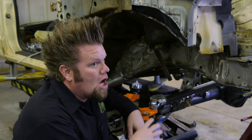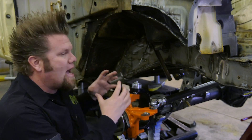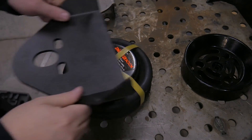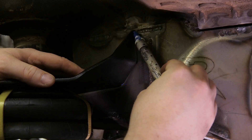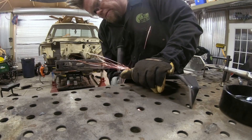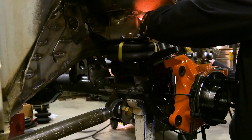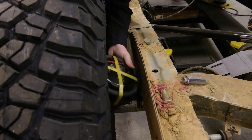This mount I had to modify a lot to make it work, and I even have it leaned a little bit forward — because I'm packaging a very special spring package into this truck. I'm going to use something I've always wanted to try: a set of airbags. Four airbags, one for each corner, and those will basically be the spring in the system. My theory is it'll give me adjustable suspension, and I'll still get lots of articulation because I'm not going to mount the bottom of the bag in place — I'm going to let the axle droop away from that bag. I'll still have about 14 inches of suspension travel, and it's just something different and cool I've never done before.